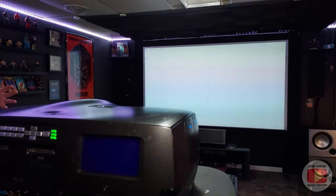So what that means is we have to tilt the projector slightly. If it's bigger at the top and smaller at the bottom, that means you have to tilt the actual physical projector unit down a little bit. This is going to be a bit of a problem because this projector unit is pretty heavy. But this D-Vision has three feet — a front left and right foot, basically where these little indentations are, and then a third rear foot in the back. So what I'm going to have to do — and this is like a 20 or 30 pound projector — I'm going to go under and bring out that foot a little more.